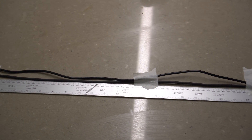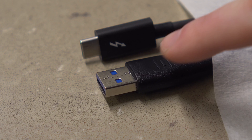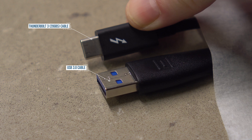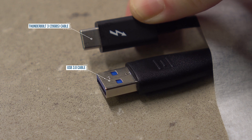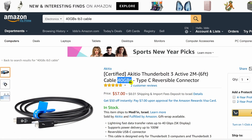The unit came with two cables: a relatively long Thunderbolt 3 20Gbps cable and a USB 3.1 Type-C to Type-A cable. We like the long Thunderbolt 3 cable but we really wish it was the faster 40Gbps cable, although those cables can be very expensive. It didn't affect our drive in any way as it doesn't even come close to saturating it, but if you start connecting other things like additional drives or monitors, this might become an issue, so keep that in mind.